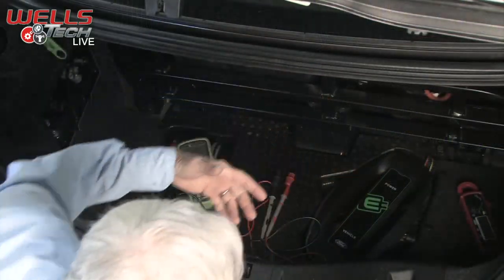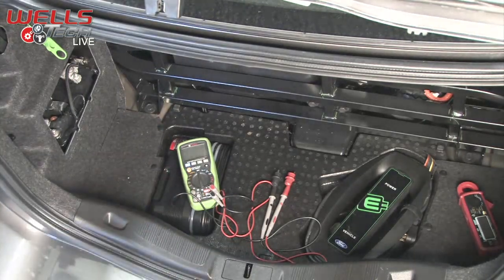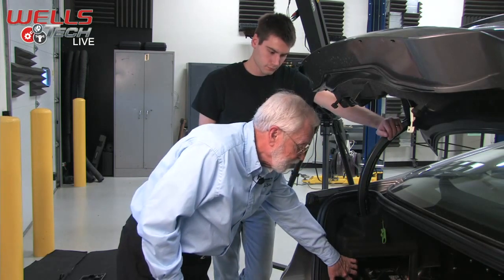Of course, this is the battery pack, and in this case, there's a lithium-ion battery in there. The battery's ECU is in there, and the DC to DC converter is in there, and we'll talk a bit more about that later. But also, the 12-volt battery is back here, and this is where we're going to go next.